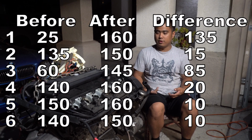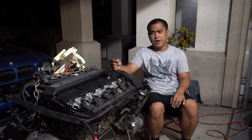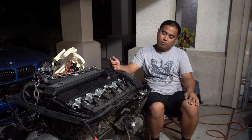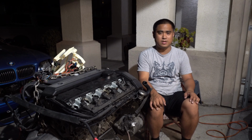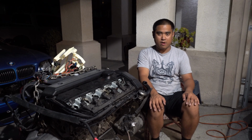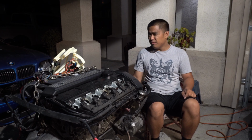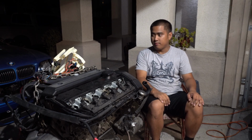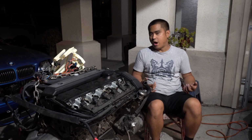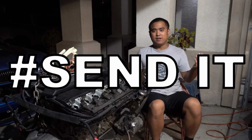I'm gonna go back to my footage and see what the numbers look like in comparison. Regardless, I don't know that Seafoam would raise compression by such a significant margin. I mean, more than 100 psi. I highly doubt that it's sealing it that well, and that I do have bad rings. Plus, on top of that, when I did a crank of the motor, nothing really came out. Exhaust valves are dry. Nothing was really spewing out. So I'm willing to conclude at this point that the motor is actually a-okay. It's enough for me to send it.